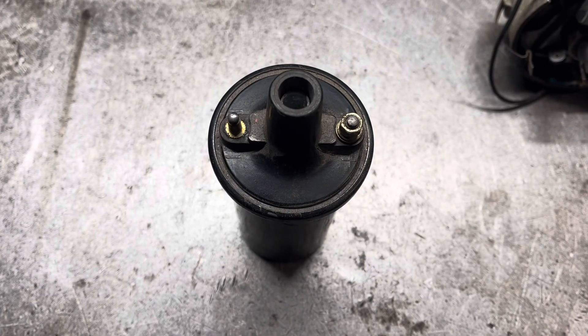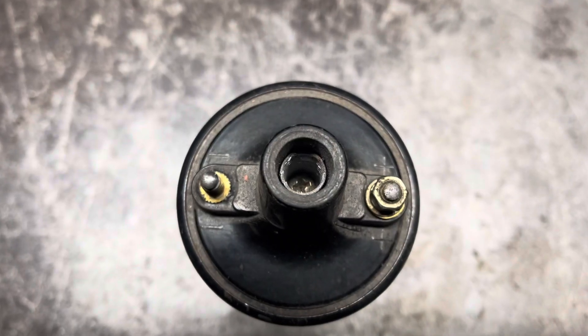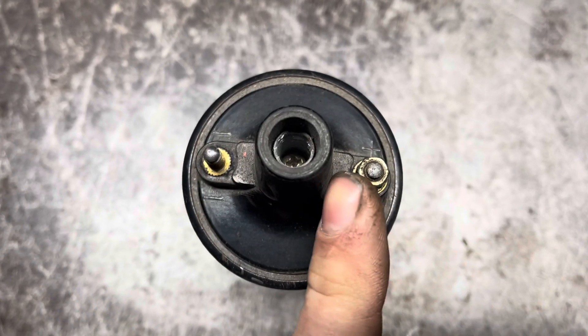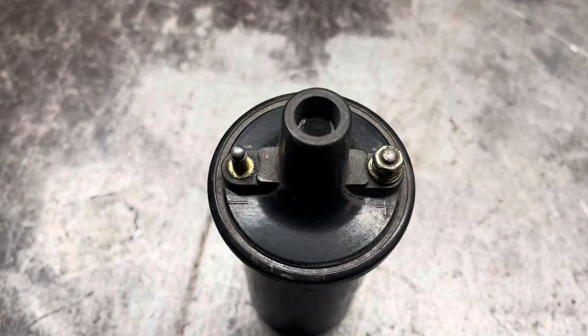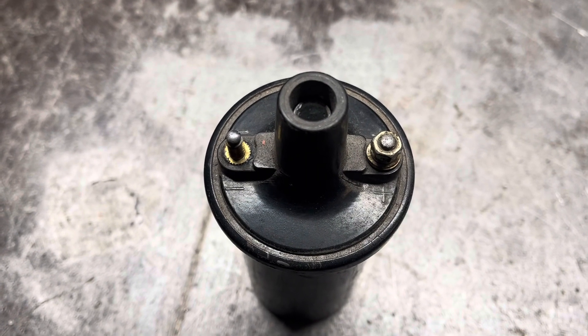Here's where the magic happens in the ignition system — the coil. The coil has two internal windings: a primary winding on the outside connected to these, and a secondary winding in the middle connected to the output. The coil makes a spark after being charged and then collapsing.